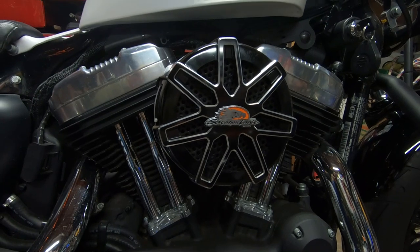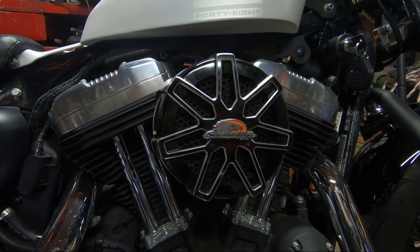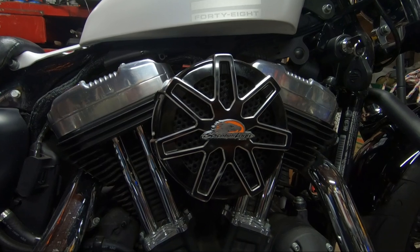Now, the 2014 model year — this is where the changes started to really roll in. Starting with the engine, in 2014 they upped the compression ratio from 9.7 to 1 to 10 to 1 compression. Not a big difference, but it is a change — arguably a little more added performance, and supposedly to keep you off having to run premium fuel. Even though they recommend premium fuel, don't run anything but 91 in them or they'll knock like hell.